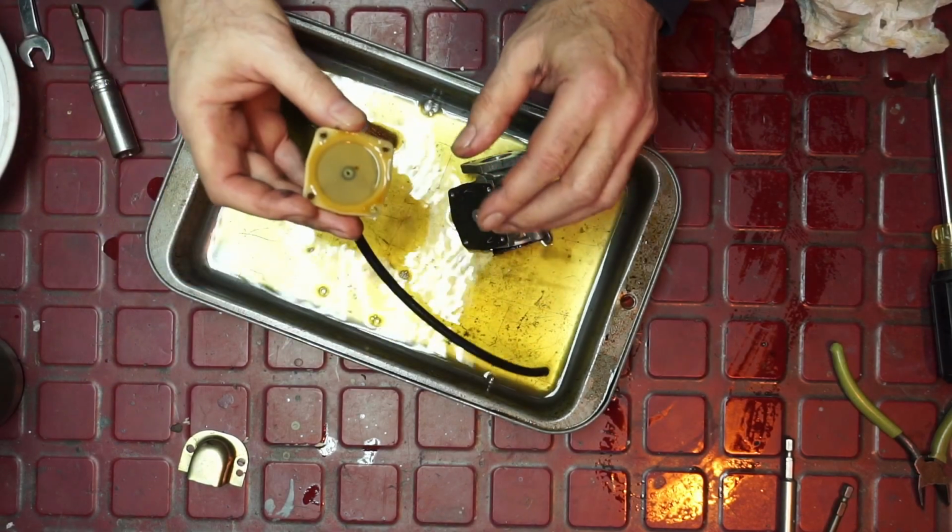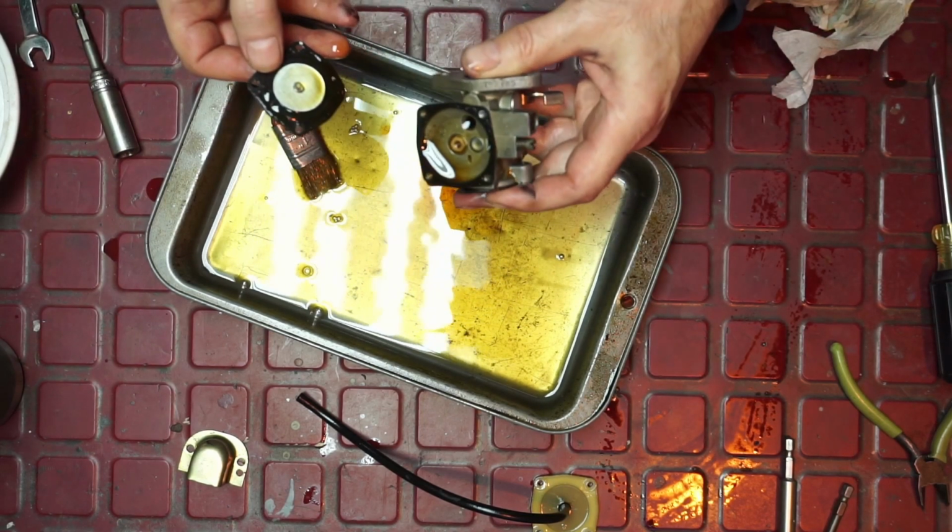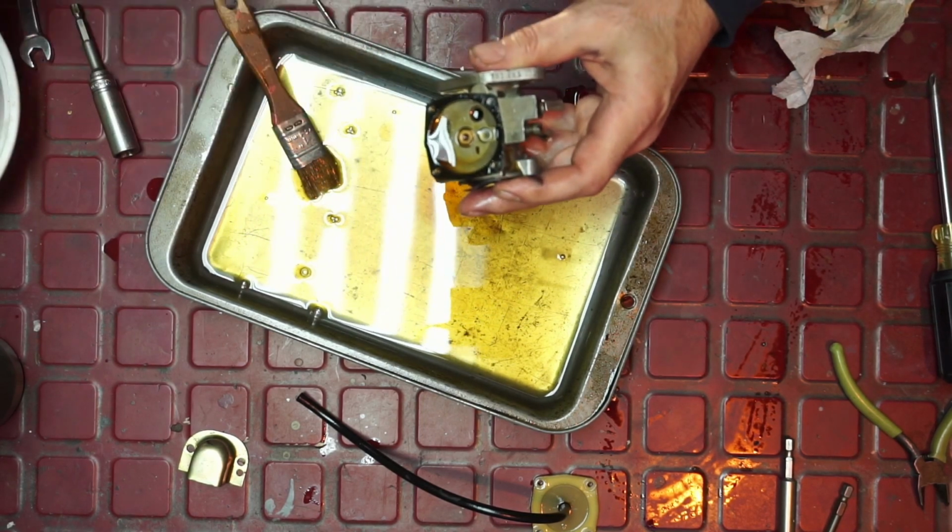and maybe the belt got thrown, or maybe something very simple. Maybe we just need to clean the carburetor and replace the diaphragm that's in there. A lot of them have diaphragms in them, like a lot of two-strokes. They're just bigger carburetors. Other than that, fellas, this one I thought was pretty nice. And as I started to get into it, it reared its ugly head.